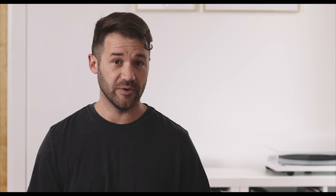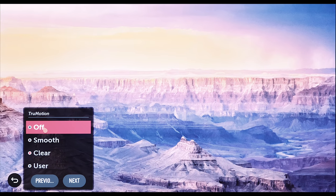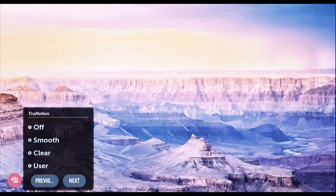Finally — and this isn't only coming from me — there is a very big effort underway by Hollywood and filmmakers to get this feature removed completely from televisions. That is motion interpolation. It takes frames and artificially inserts frames where there aren't any, in order to give you the smoothest possible picture. But what it actually looks like is a really bad soap opera — which is why it's called the soap opera effect. So just turn it off.